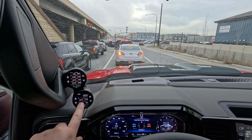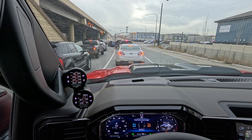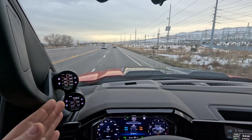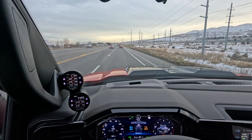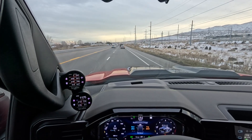Now that we're warmed up, RPM is sitting at 700 RPM, which is typical — nice and quiet. At 900 RPM it was regen as well as heating up the engine. We got the magical DPF soot level at zero percent, DPF regen at one percent. I'd love to see that at zero percent, but we got it close enough.